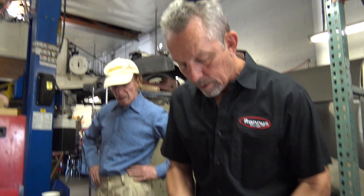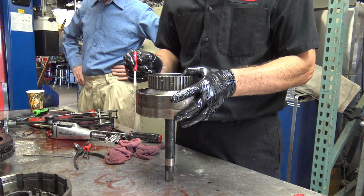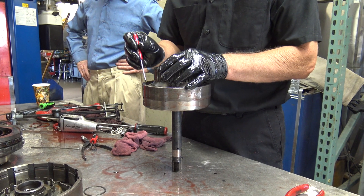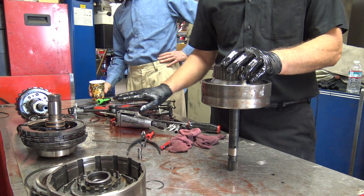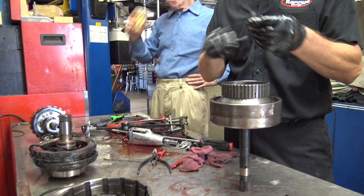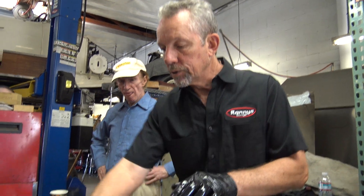This one is almost exactly the same. Springs don't cover them — these will be fine. Typically on a spring, if you stand them all up and they're the same height, usually okay. If you have shorter ones, there's heat damage, and you can usually see it. Heat damage will make a spring collapse if it gets too hot.